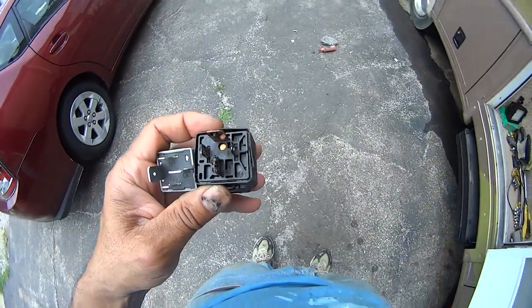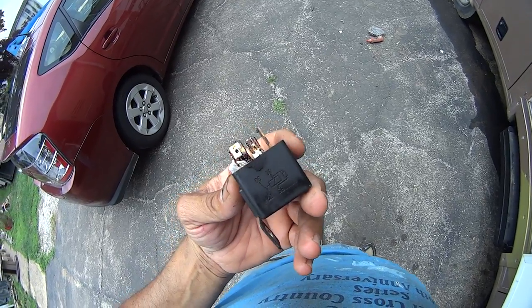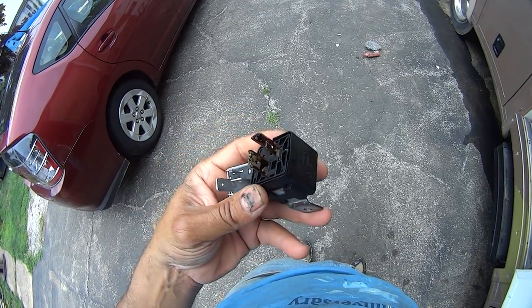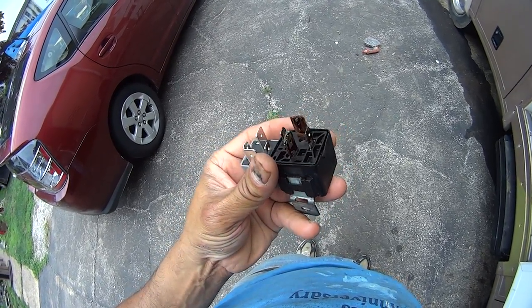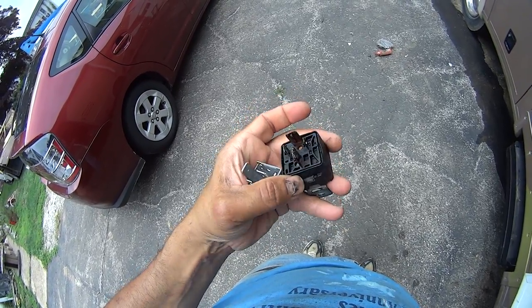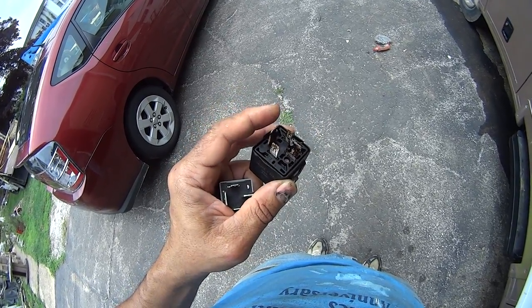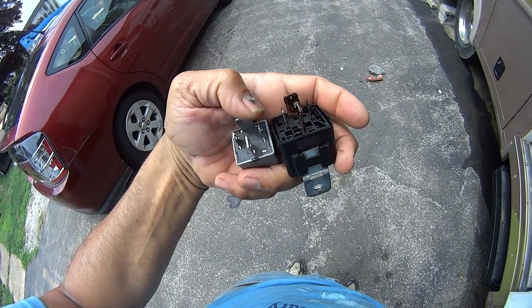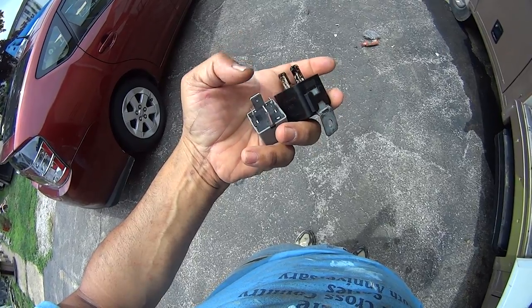And now I'm going to go for the fuses. Okay, to the right here, this relay operated correctly. But as you can see, it's got all that oil on it from the connector. And so I'm not sure what's going on there, but I'll just go ahead and replace the relay. It's $10. This relay will be out of the formula as far as what could possibly be wrong, because I'm dumping it. And then I'll replace the boot that connects this if I'm still running into issues. Here we go, $10, and I've got to just mount this onto there. No big deal. We'll just mount it up.